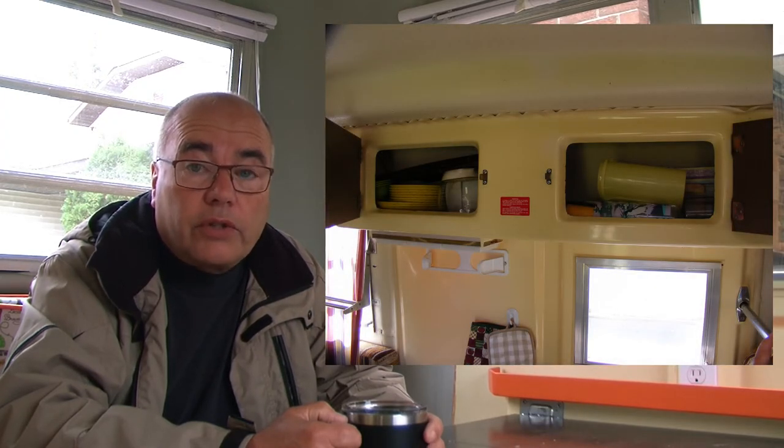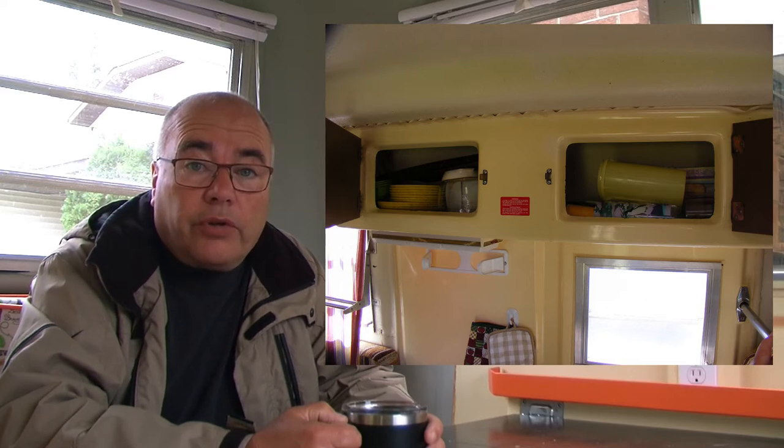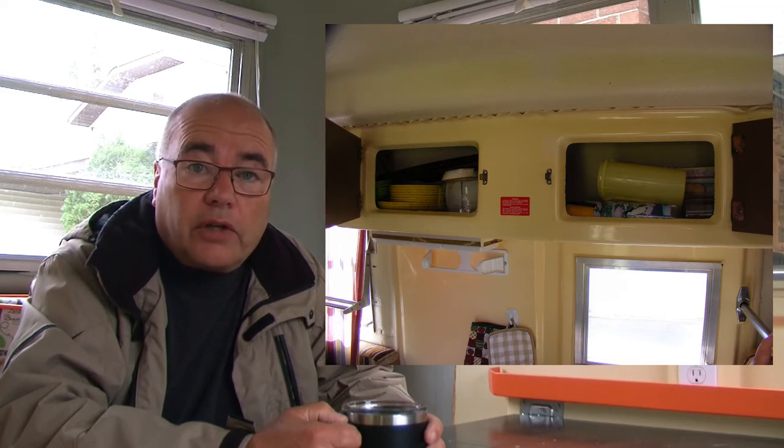and we felt it needed to be replaced or fixed somehow. After doing research on places like fiberglassrv.com and whatever other sites I could find, it was recommended by many to just heat up the T-molding in a pot of hot water, allow it to soften up, and reinstall it back in the T-track. Well, we tried that, and yes, it worked.